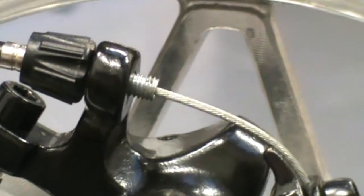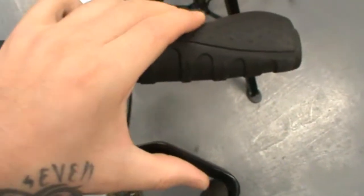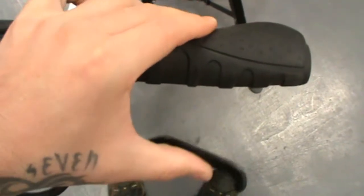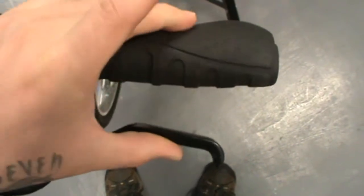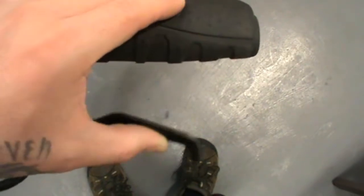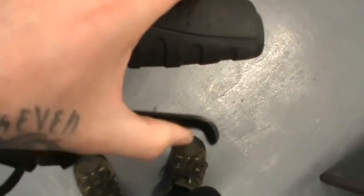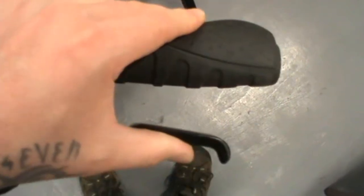The last time we were pulling this brake lever, there was no space. I've only adjusted one brake pad, nothing else. And already there is loads of room in there — about two fingers of gap. What you're actually trying to achieve is the brake lever just about parallel with the grip, or just not quite parallel. If I pull it really hard it'll go to parallel — which means that brake is actually adjusted correctly.